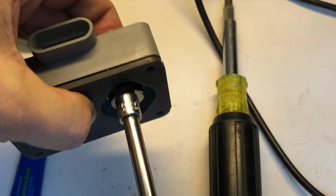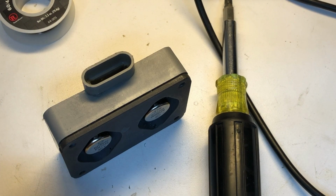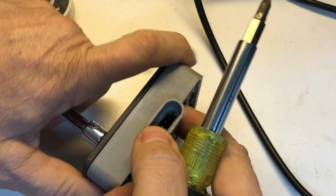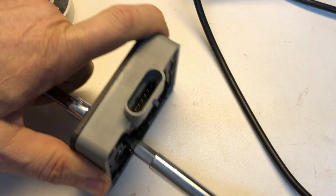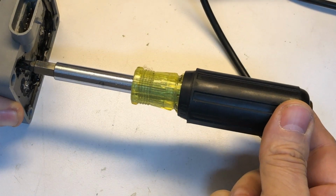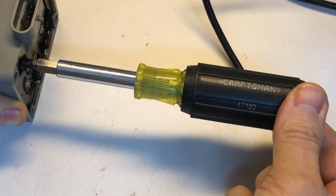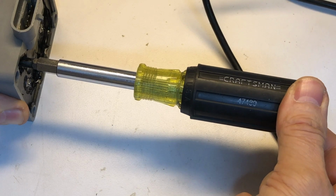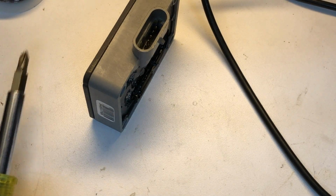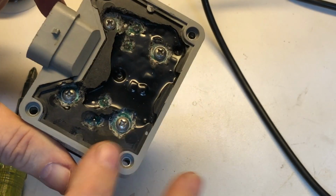And then we're going to talk about torque. So obviously there's no specified torque value. These things were not meant to be rebuilt. But I can tell you just from looking at a brand new one out of the box, it's very, very low. Only a few inch-pounds. And I don't have a torque wrench that actually goes that low, so kind of going to use the two-finger method. And I'm just going to twist this with 2 fingers until it feels snug. And once I got this where I can't turn it easily with 2 fingers, I'm done. That should put us in the neighborhood of around 9 to 10 inch-pounds of torque. And that's what we're going to want to do on all 4 of these. So we're going to go ahead and do that, and then we got one more step after we get everything torqued down.